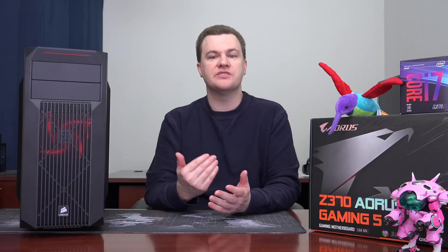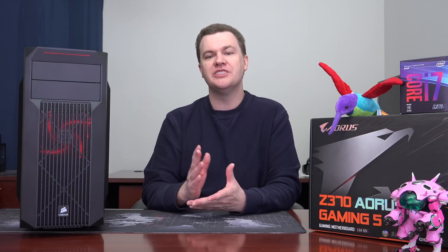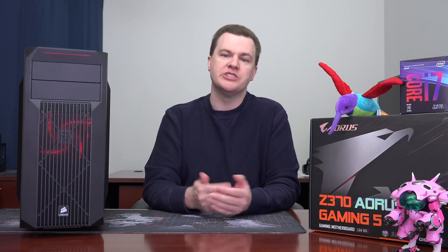In terms of the BIOS itself, it's fully featured with tons of options, but since we have a non-K chip, there's a limit to what you can do. Setting the memory to DDR4-2400 using the XMP profile was of course not a problem. If you buy faster RAM, it will run faster because it's a Z-series board. But overclocking the CPU is going to be very limited — not a K chip. Can you use multi-core enhancement? Yes, but unfortunately it doesn't do anything. I played around with the overclocking settings, set all the ratios to 46 manually, turned on multi-core enhancement — nothing. It would not run all six cores at 4.6 gigahertz no matter what I did. There are some boards that may do it, but this one doesn't. 4.3 GHz on all the cores is all you're going to get, at least with this board and this CPU.